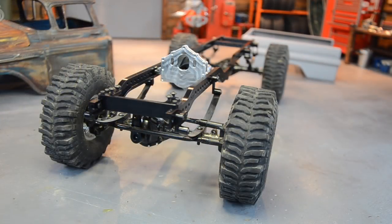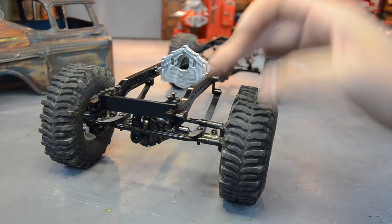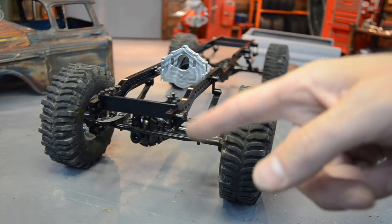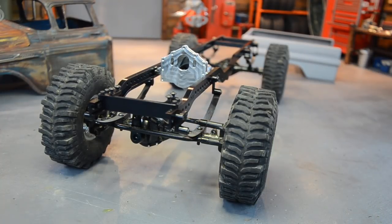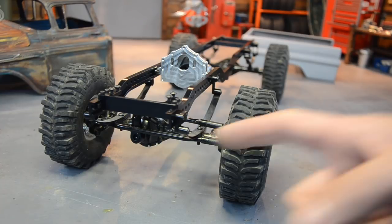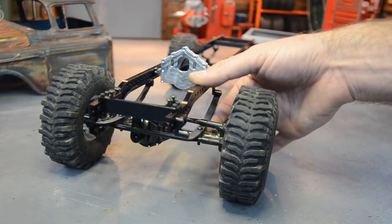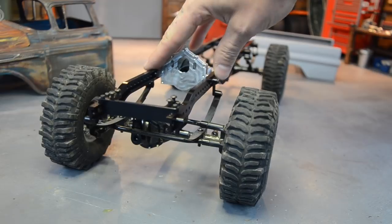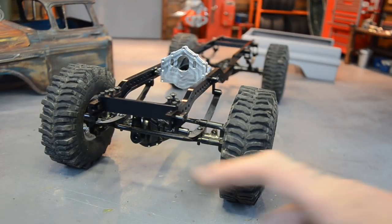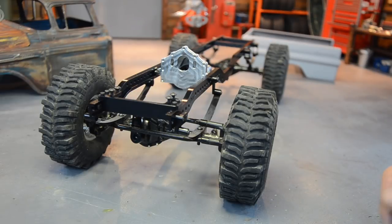All right, so you can see here what I've done. I basically just swapped the sides for the hanger and the shackle. They are both one-sided and it has an offset smaller, this is probably a 1.5 mil screw or something, that helps capture the leaf on there. Doesn't look that sturdy, but it actually is. And I'm sitting here messing with it. I can't pull it off. Everything works and jives right. So I just flip the mounts, sticking outward. They're perfectly parallel, fit the axle right on, just like it would have the other way.